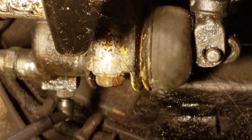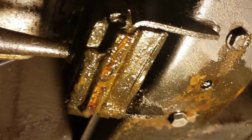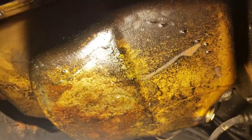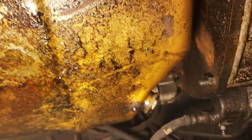There's a whole bunch of gunk down here — a lot of it is undercoating, and that's transmission fluid right there, dripping from back here onto the crossmember. It doesn't look like the gasket itself is leaking from the transmission, but it's getting all over the place. Very messy under here. I need to get under here with some Purple Power and clean it up. The oil pan looks pretty dirty — need to check if that oil's coming from the plug or the gasket itself.